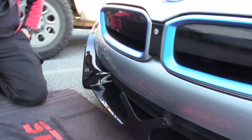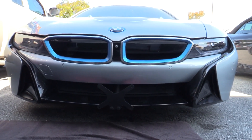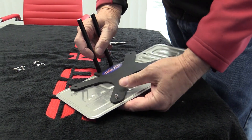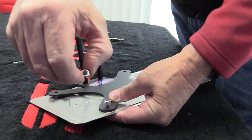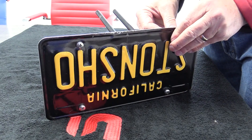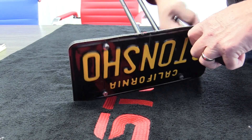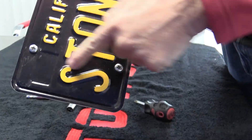Make sure you remove it before going through a car wash. That's where your license plate goes — on the front plate. Now we'll show you how to mount the license plate to the front bracket. Take your plate, put the screw through the plate, line it up on the bracket, and put the nylon lock nut on. The nylon lock nut has a nylon ring — the ring goes to the outside. Then take your 10mm socket or wrench and Phillips screwdriver and tighten them up. The ring will keep it from rattling off. That's what it should look like when you're all done.